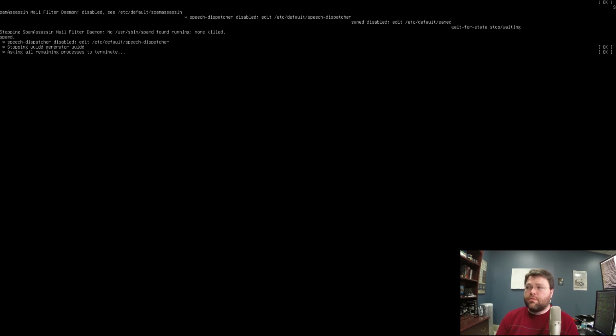While we're waiting for it to restart, you could go ahead and hook up your hard drives. Because you didn't have your hard drives attached, it's up to your UEFI to pick which device you boot from. Now, you can configure the boot manager. My favorite one is called rEFInd, Refined. It's kind of funny. It's sort of an EFI boot manager that lets you pick between operating systems.